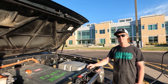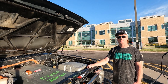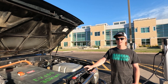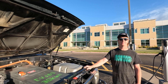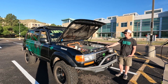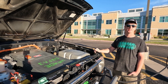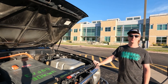He's taken it up to Kingston Peak, about 12,000 feet, arriving at the top with 18% battery and recovering to 30% through regenerative braking on the way back down. Normal driving range is about 60 to 70 miles, and off-roading is around 50 miles — roughly half the range of a Leaf with the same battery, but it's twice the size. Above 65 mph, aerodynamic drag causes the battery percentage to drop quickly.